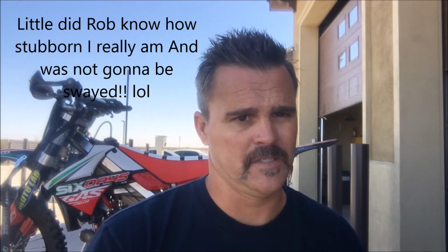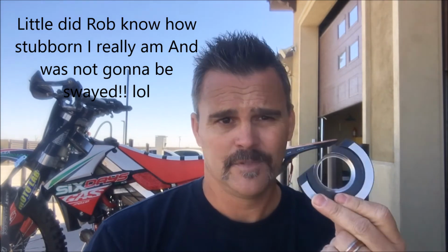So that's why, if it did vibrate too much, I had him just use this one that I picked off of eBay, and I kept the original. I can't put that back on, and that was another reason why I didn't want to machine the original one down. So if it did vibrate more than it does, I just put it back on. And as it turns out, I don't feel any more vibration than I ever did before. The only difference is this bike revs super fast now. I've taken all this rotating mass off of that crank, and holy crap, it revs really fast.